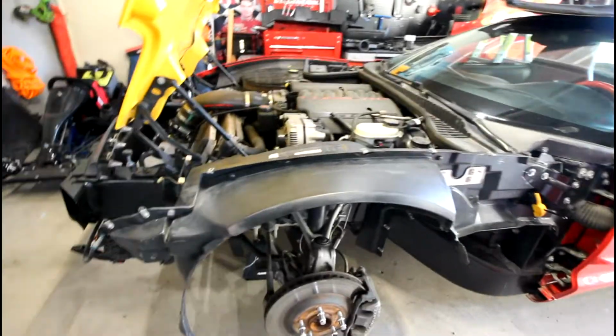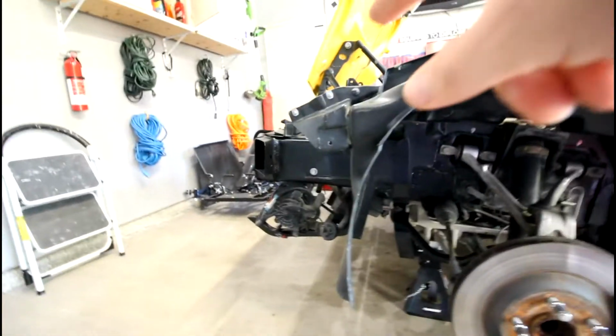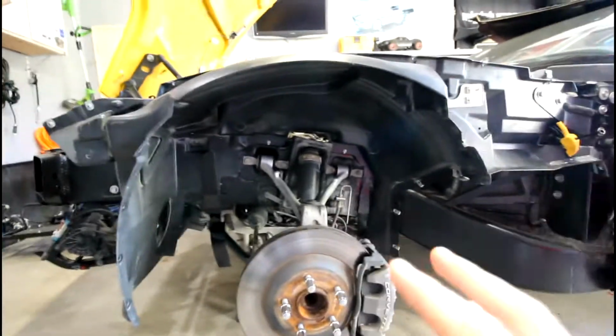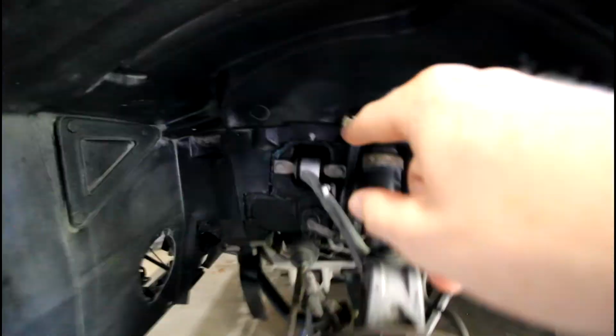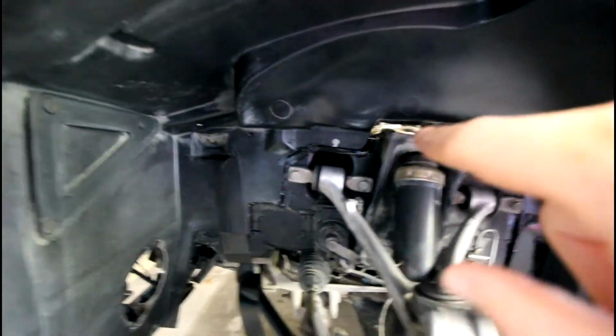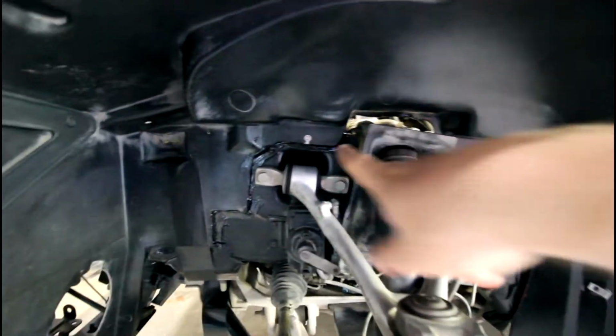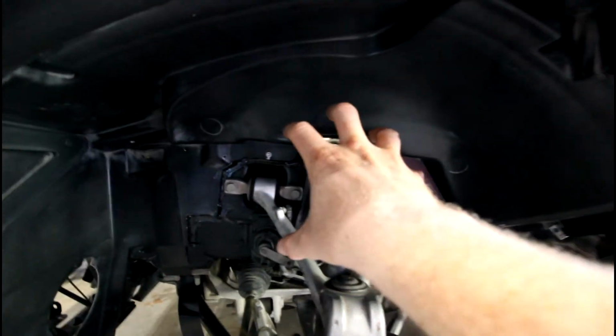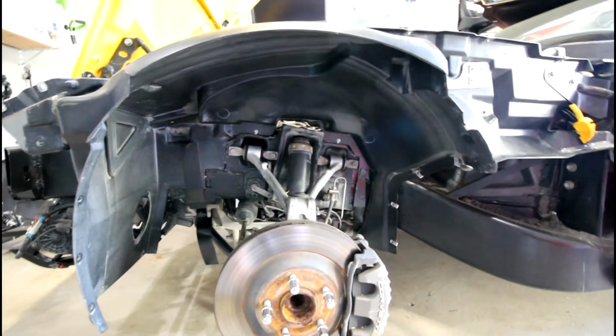So what I did first was I basically got the headlight bracket and that firewall bulkhead bracket, mounted that, and then the critical thing was getting some nice stainless steel hardware with nylon lock nuts and really cinching it down here and here. That really just helps pull the fender like that and sinks it right onto the frame of the car so that the inboard-outboard gapping is correct.